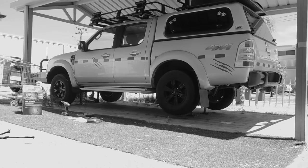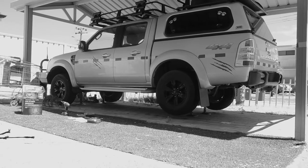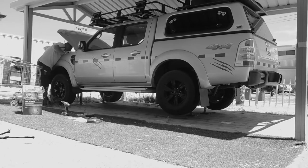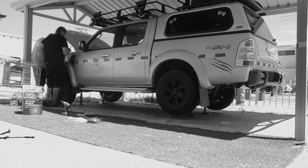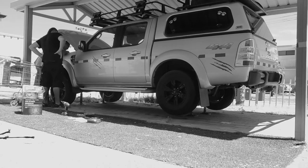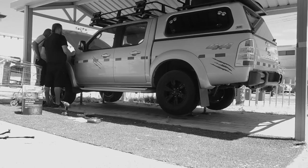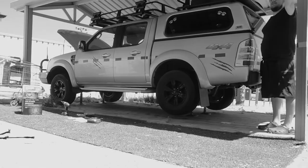Chapter 4. We then press the PVC tubing into the breathers at the front and rear differential. We then mount the breather bracket onto the engine bay chassis with a mounting screw and bracket, making sure we mount it to free space on the chassis. This is done with a drill and drill bits 3 mm in size.